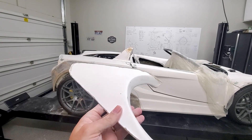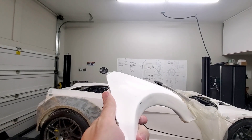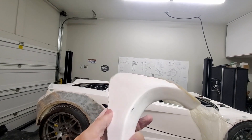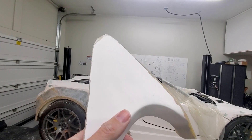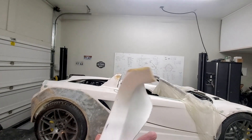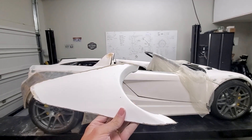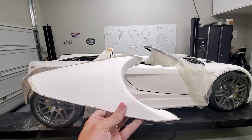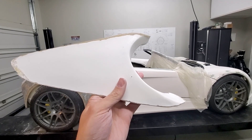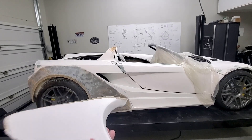This is the part from the second mold. Got it cleaned up, looks pretty good. It's pretty dang smooth. There are a couple of color mismatched spots — not divots or anything, just smooth with some color variation. I added some water to the PVA and did a couple extra coats; I think that helped a little bit. Somebody mentioned just skipping the PVA and doing wax, so that sounds interesting — I might try that if I do another one of these.